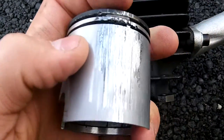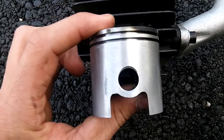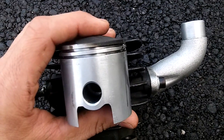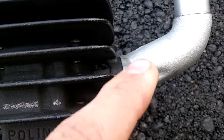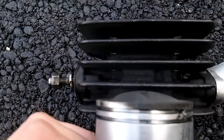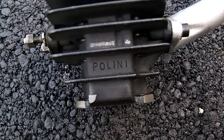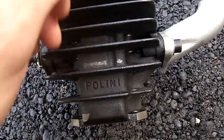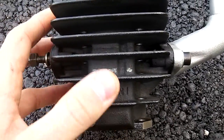Because what happens is the crown of the piston doesn't actually uncover the intake port. It comes down just enough so that the exhaust opens, and then the intake lets a new charge in on the upstroke. This port is actually way down here - it looks like it comes in right here, but it actually comes in and goes down. So this never actually uncovers that. It uncovers the exhaust port, but then when it comes up, it uncovers the intake, and the intake goes in underneath into the crankcase. Because this is two-stroke - this is how two-stroke works. On the upstroke, intake comes in. On the downstroke, it pushes intake up through the transfer ports, which are right here on the sides. And the exhaust goes out while the new charge is coming in from the transfer ports.